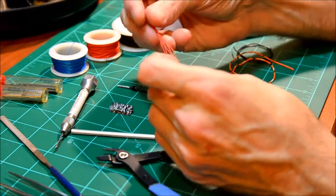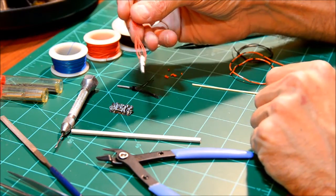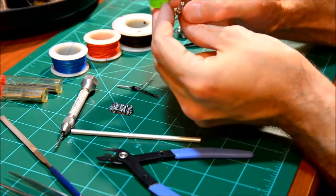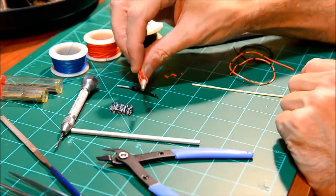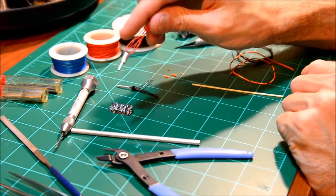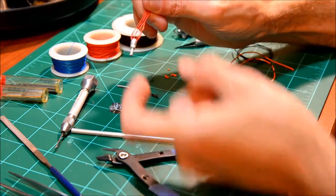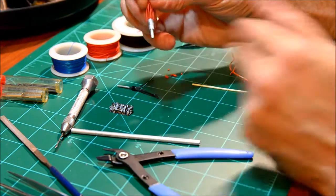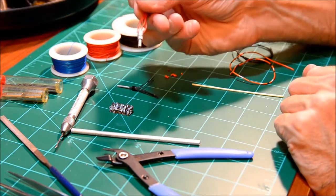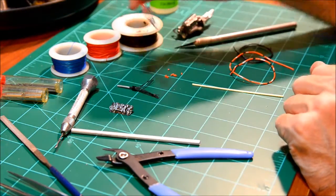This is one I made for a drag car — it's more of a magneto, it's quite large. But that's just another example of how you can use concentric tubing to get a distributor. The same theory is you glue the wires around the perimeter of the center shaft, then slide a collar up over it, cut everything to length, paint it — or if you make it out of aluminum, it's kind of cool looking just in aluminum.